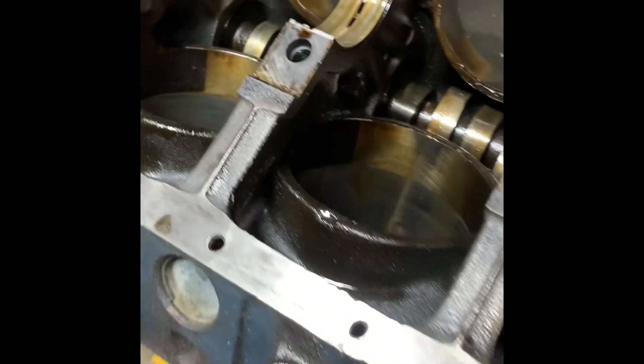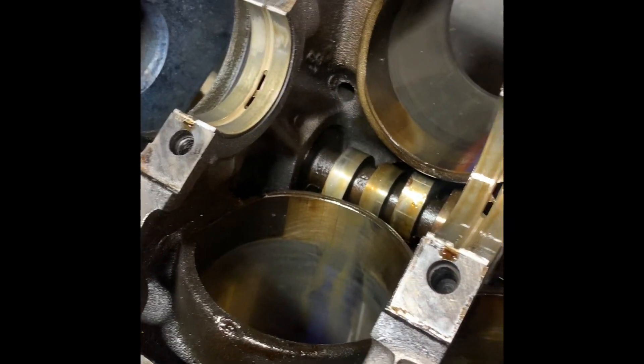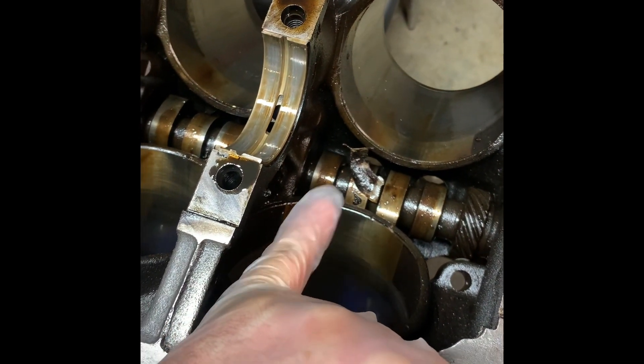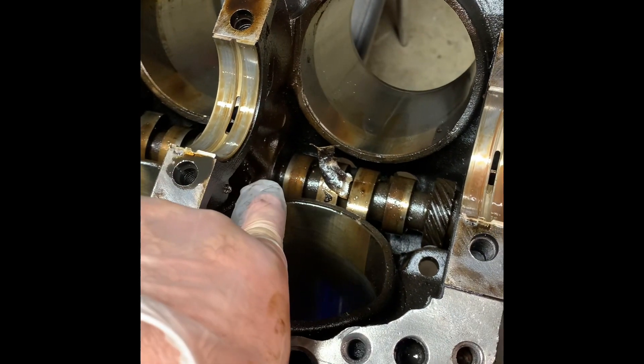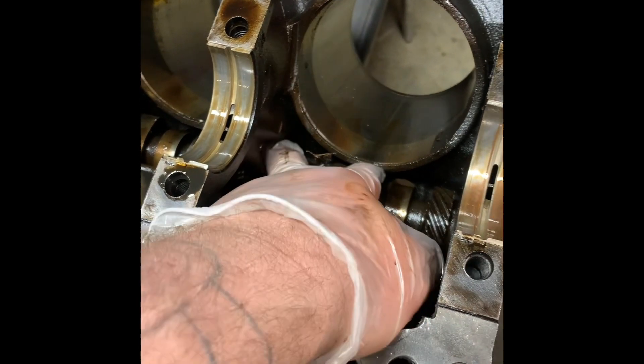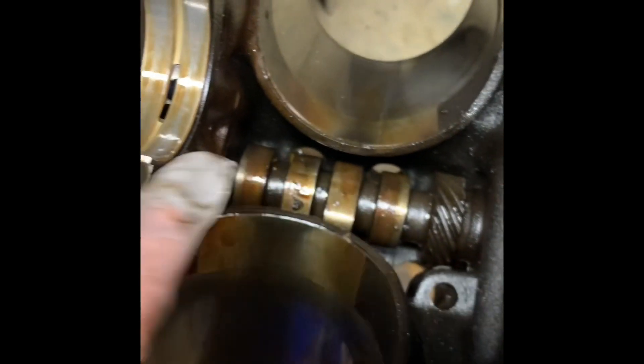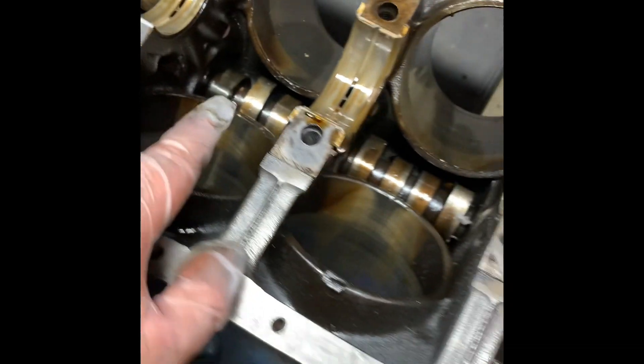Now you can inspect what's going on here. I had a freak-out because I thought — sometimes you get the camshaft bearings and I've seen them tear up like this — but it was a leaf. So far I don't see any bearings that are bad, which is good. The cam looks pretty good. I might just clean it up with a soft brass brush, then take it out — it should just pull out, but you gotta take out the retainer clip first.